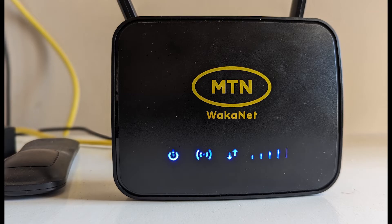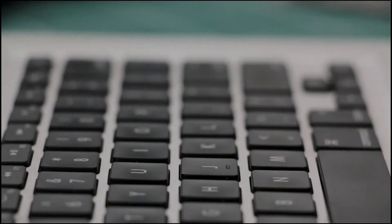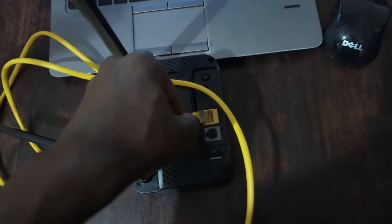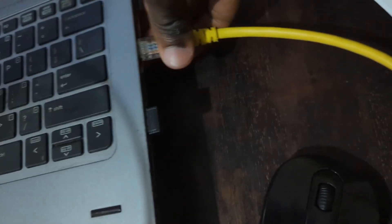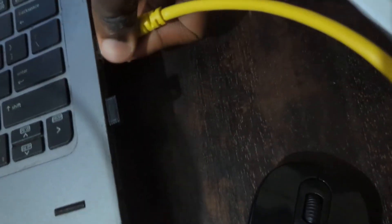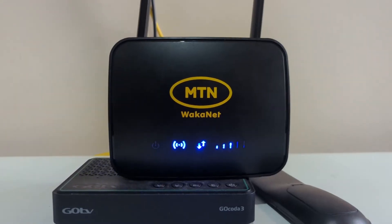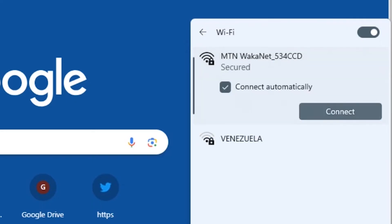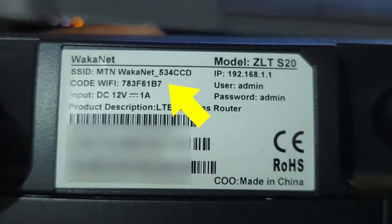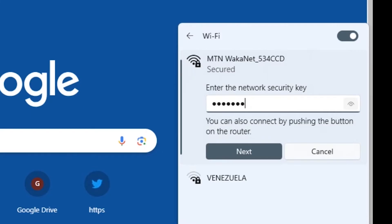To set up the Wi-Fi password and Wi-Fi name that you desire, you can use a smartphone or computer — both will do the job. On the computer, you can connect a cable and set it up easily. But for those using smartphones, let's use this method that works on both computers and smartphones. With the router on, connect to the Wi-Fi. The password is at the back of the router — on mine, it's just below the SSID and labeled 'Wi-Fi code'. Input the password and you're connected to the network.